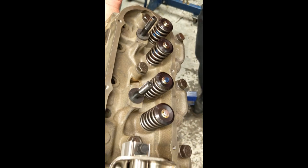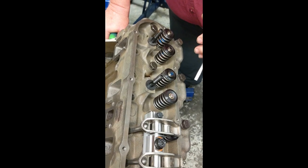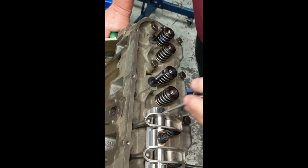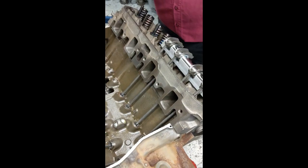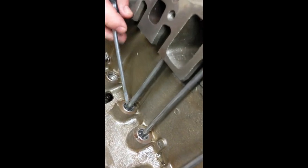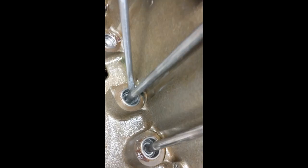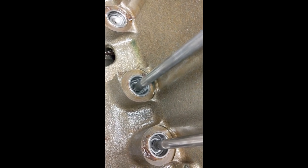Once you've got your geometry located on the rocker arm, then you put the pushrod in and bolt it down. This end of the head's already been done — that's when you check your preload and pushrod length. You want to make sure that the lifters are down; this one is. You can see how much it's depressed the plunger from the retaining clip. I'm going to push on the rocker arm — you'll see it's going to move some more. There's still more travel there, so we're kind of in the middle of travel — that is good.